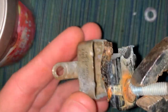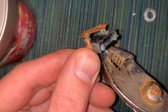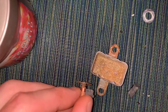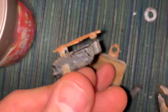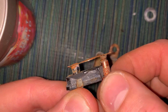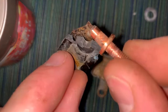So this obviously goes in there, and that's just a case — the case really doesn't matter other than mounting. This copper lug goes in there and holds contact, and then once it heats up the copper lug stays in place and then this piece, as we saw earlier, will ping away — just a sixteenth of an inch, just enough to break the circuit.